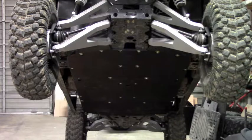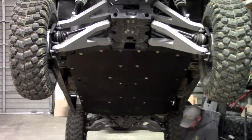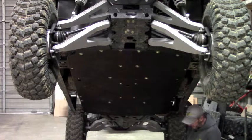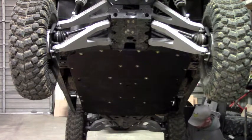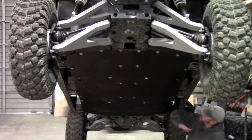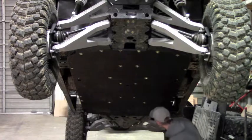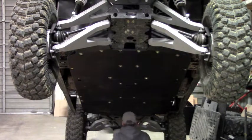And those are going to be your bolts with the washer and the spacer, and then another washer and a nut. And the spacer on these bolts, like where they're used on the clamps, back here and then on the rear plate, is actually to keep from over tightening the bolt and pulling it through the plastic. It's essentially a stop. There is some compression, so it will sandwich the plastic down to hold the plate on tight, but you're not going to be able to just keep going, and you can actually pull these bolts right through the plastic without that. So that's what the spacer's for. It's essentially just a stop.